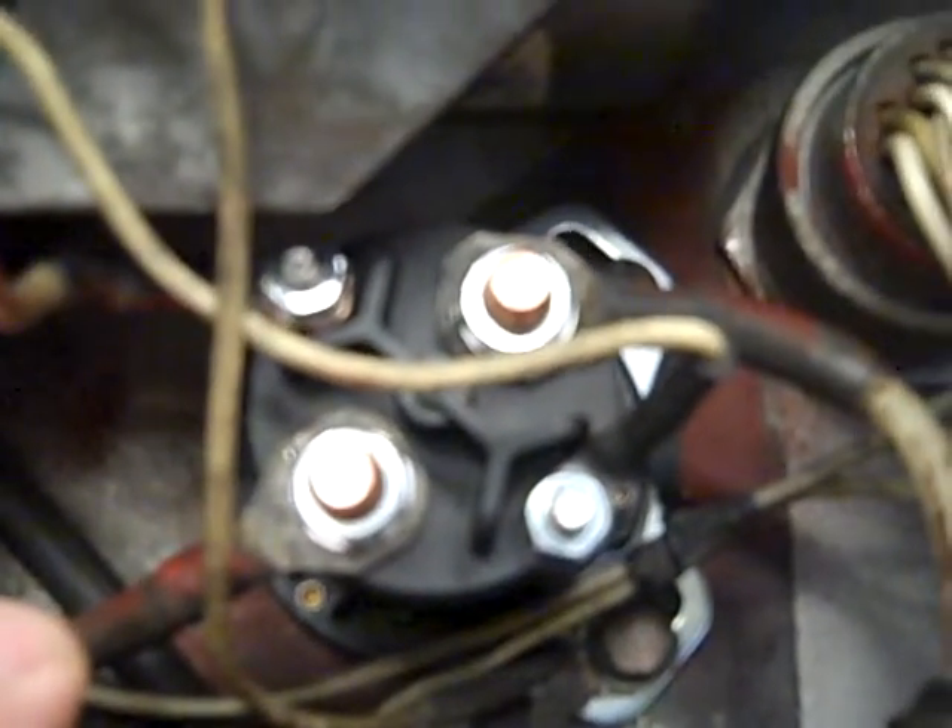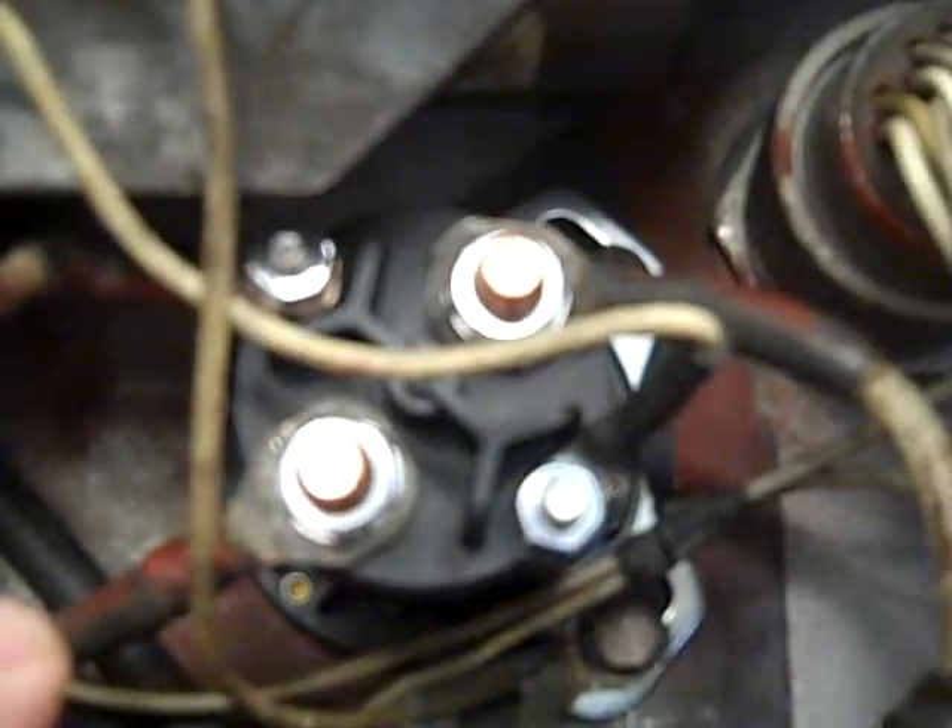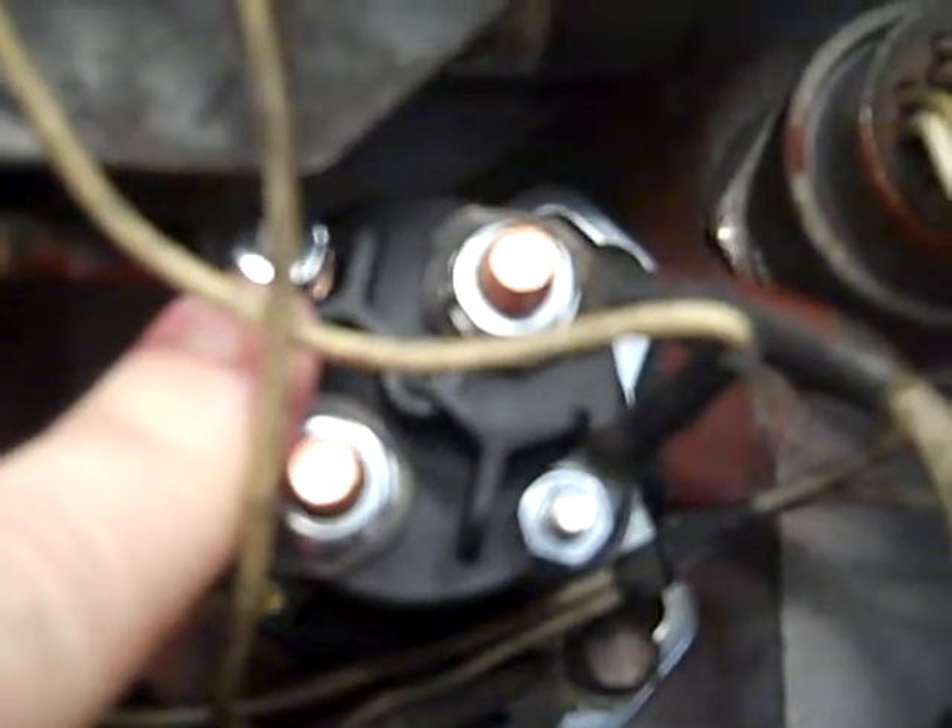When we're talking about the magnetic switch, we have four terminals on here — two large ones and two small ones. The two small terminals would be our control circuit. One of these terminals would be switched power coming from a key switch, a relay, or any other switch, depending upon what accessory we are trying to power.